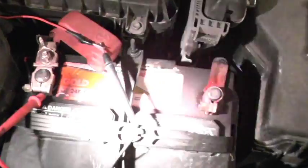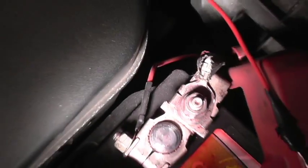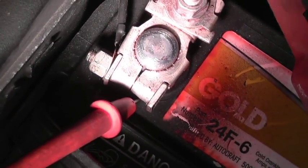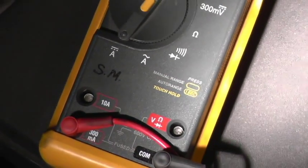I disconnected it — let me turn the light on so you can see. It's disconnected right there. I crimped a new connector, cut the brown connector off, and connected it to this exact same location where the power cable from the relay is connected. I have a meter connected to show you how much current that small LED on the switch draws.